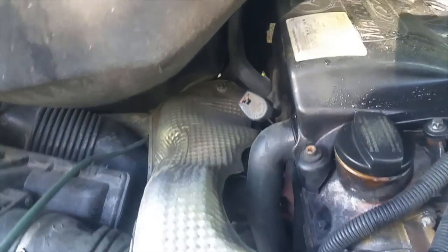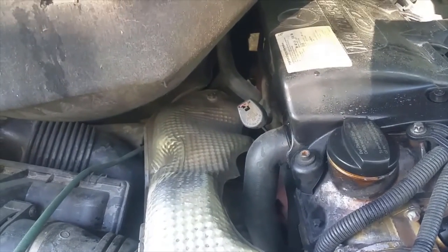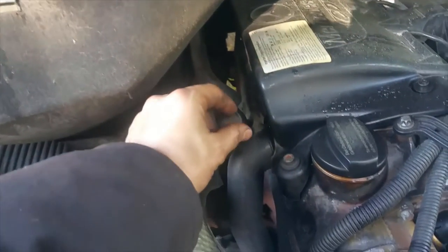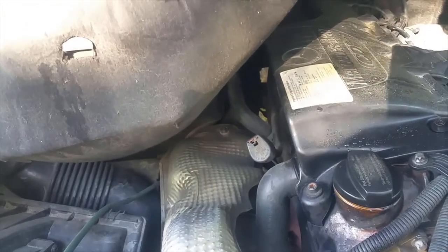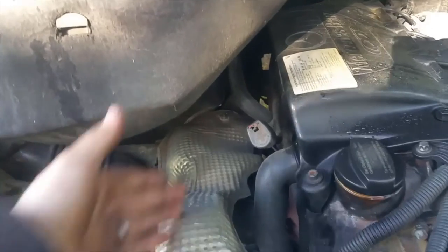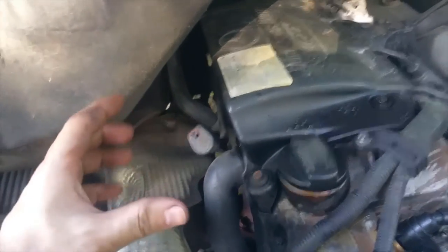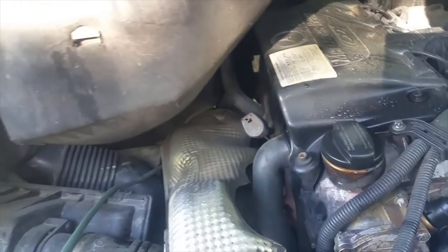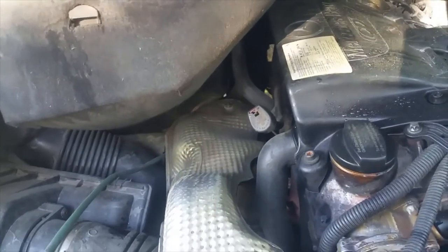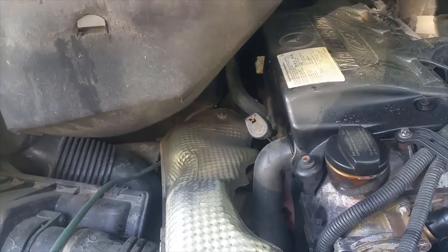There's no need to remove it right now. It's obviously a transmission fill tube. What you're gonna need is a regular fill jug - not even a transmission-type fill jug like they sell in the store - because you don't need it. Your transmission fill tube is right here, so you're gonna need a small funnel, just enough to stick it in like a pipe where it's not gonna fall out as you're adding transmission fluid.